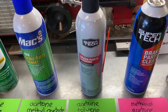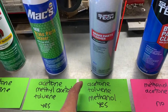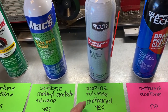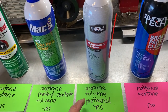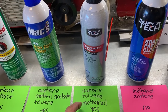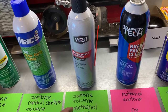Next are two products marketed by Walmart under their Super Tech brand. The first is Brake Parts Cleaner, non-chlorinated. First ingredient is acetone, then toluene, and they're also including methanol. Alcohols dissolve different kinds of things and are good at taking off grease. So you've got the acetone, the petroleum distillate, and methanol, which will take some adhesives off and other types of chemicals. Remember: like dissolves like.